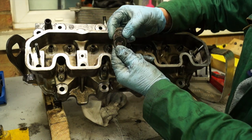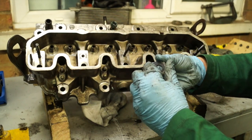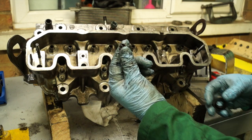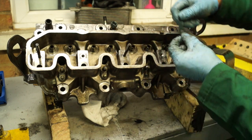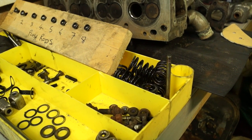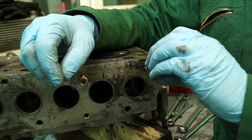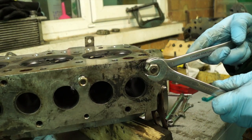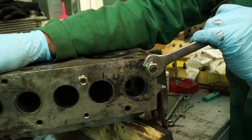This has been quite a long tutorial and I hope you understood what I was talking about. One last reminder: underneath the valve spring on the cylinder head you have some wear plates. You would have taken your stem seals off, which facilitates getting these plates out — I had to use a little bit of air to blow them out. These are important as they stop the spring wearing the aluminium head. There are plenty more tutorials to come on this, with more jobs to do on the cylinder head before we replace anything. Here's a little trick: use two nuts wound together and locked on a stud — this will help you remove studs from the head, as they can be awkward at times.